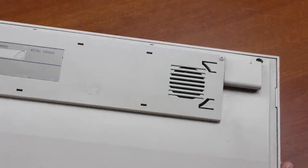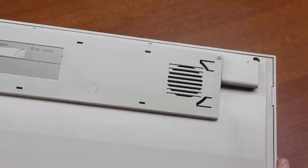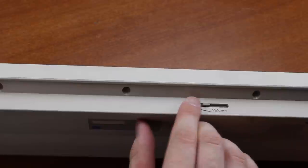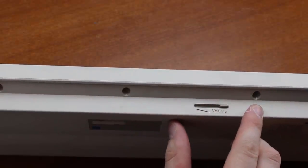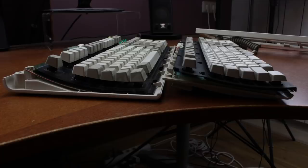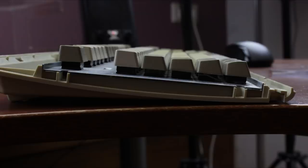Also like a Model M, it's got a speaker grille at the back, but the 5576 does actually have a speaker behind it, plus a volume control which slides back and forth — though the one on this keyboard doesn't seem to work. Perhaps the most notable similarity to a Model M is that the keycaps use a uniform profile, with a curved assembly to generate a sculpted profile instead. Other than on the Model M and F, this is a fairly rare feature for a keyboard. Most keyboards generate the sculpted effect using a cheaper flat assembly, with sculpting done keycap-side instead, at the cost of losing this interchangeability.